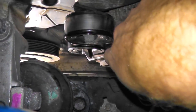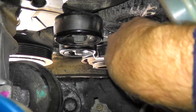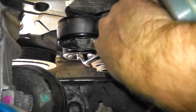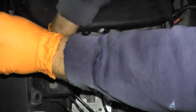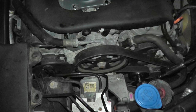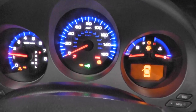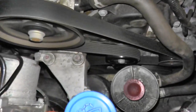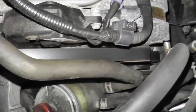If you're curious about the torque readings, the 14 millimeter bolt is roughly 35 foot-pounds, and the smaller 12 millimeter is 16 foot-pounds. In this case, I'm just going to do it by hand. Before I replace this cover, I just want to make sure that everything is running the way it should be.